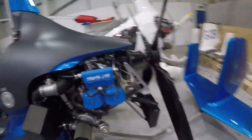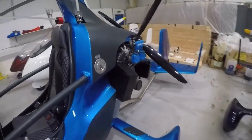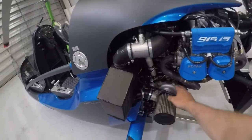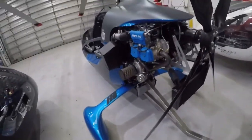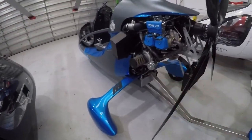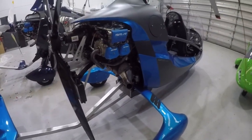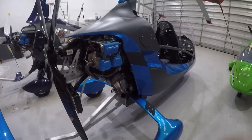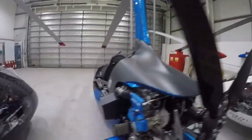How does that translate to take-off performance? I've always been of a mindset that many gyroplane manufacturers have overstated take-off performance, because gyroplanes are typically not the shortest of take-off aircraft. However, with Rotax 915 power in the 2017 Sport you can't say that anymore. If you only pre-rotate to 200 RPM to clear 50 feet, you only need 100 feet. If you pre-rotate to the higher values — typically 300 rotor RPM — you still take 100 feet to clear 50, but the aircraft unsticks so much sooner, which means if you operate off a rough or grass airfield you'll find the ride much more consistent, smoother, and with a lot less wear on the undercarriage.